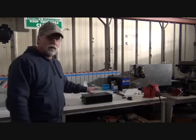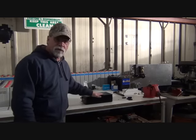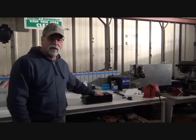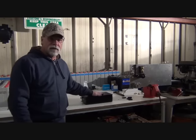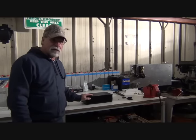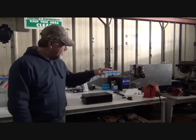Before we mount the controller, we're going to put some heat transfer grease — or compound — on here. This is going in a DC conversion, so we want to make sure we use a non-silicone heat transfer compound, because silicone damages the carbon brushes in a brushed DC motor. So always be aware: don't use silicone around your brushed DC motor. We're going to spread a layer of this compound to aid heat transfer between our controller and our heatsink, then mount it in place.